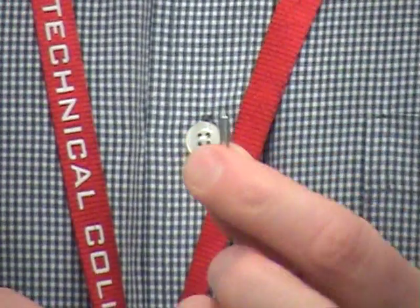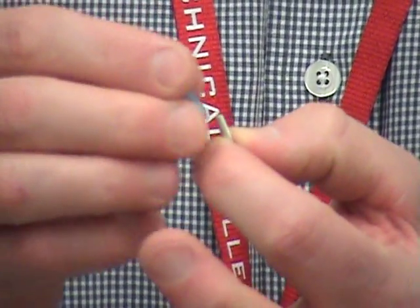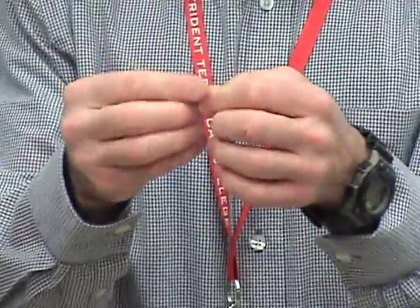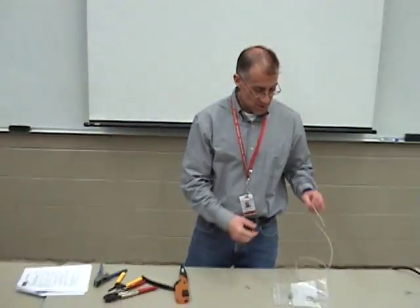The environmental splice — when I splice the inside piece, I'm going to splice it and then lay over my heat shrink. The heat shrink has little gels on the end. When I shrink it, it's going to environmentally close off that splice.